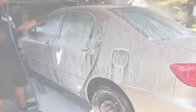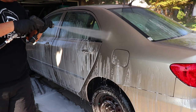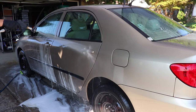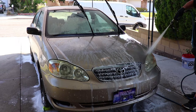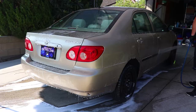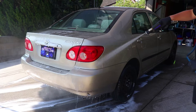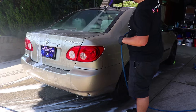After a moment of soaking, I rinse away, and as you can clearly see, the paint is looking a whole lot better, and I haven't even touched the vehicle. The APC foam pre-rinse is what I like to call the one-shot bomb, because this will cut through a vast majority of grime, allowing for a safer yet efficient way of cleaning. If I had gone straight to rinse and foam for a contact wash, the wash mitts and detail brushes would be junked with contaminants that could spread and swirl or scratch the paint. Understanding how a product works from a chemical standpoint makes your details safer and requires less agitation — more cleaning action and less back and wrist pain.